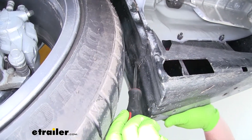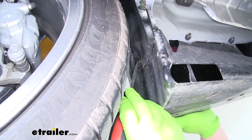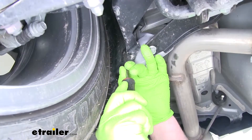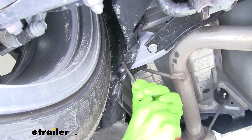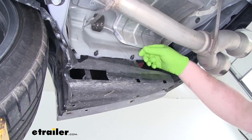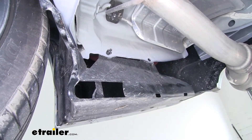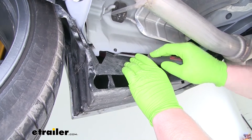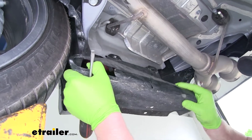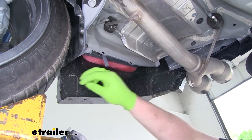We're going to have two more right behind our back tire — these are going to be a little bit different and a little tough to get to. We're going to use that same method to get them out. For the ones on the inside, what we're actually going to do is just push the back of it. With all the fasteners removed, pull our panel out and set it off to the side. We're going to do the same process on the other side.